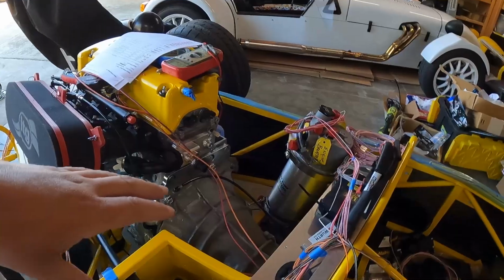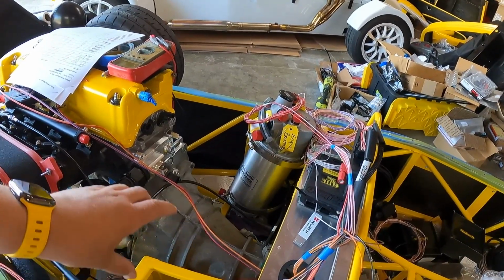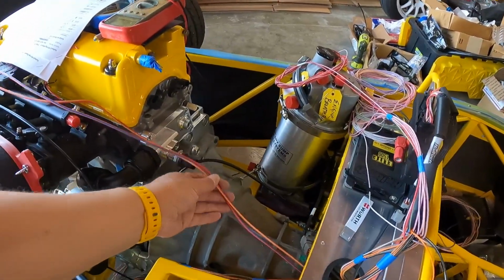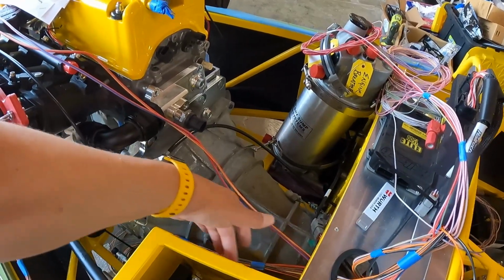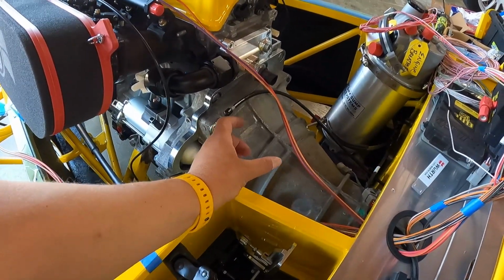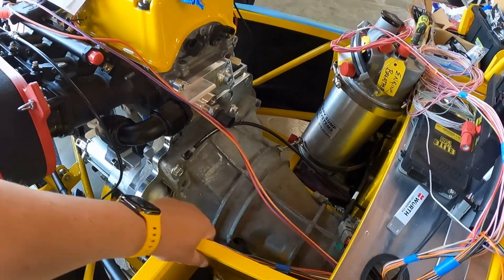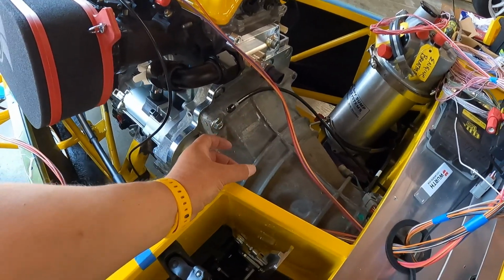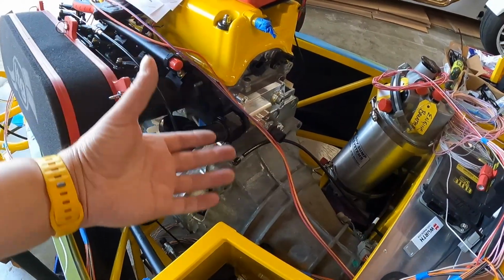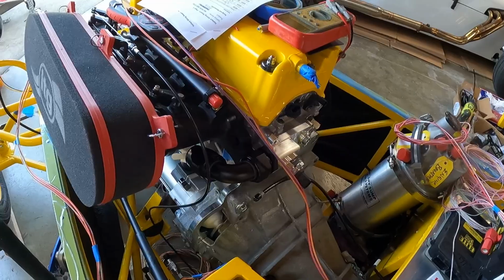So our last leg for wiring are these two wires here. And as I mentioned before, we're going to have basically a trunk harness just for the engine side. What I'm thinking is these two will be in that, but we'll run it along the side here with this other bundle, but separately. And I want to have a bulkhead connector that sits just right here, and that'll kind of help hide this other harness below it. But then we'll have just a single disconnect right here that, should anything happen and we need to pull the motor really quick, we can just disconnect that wiring harness and pop everything out of the way.